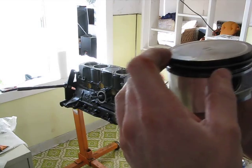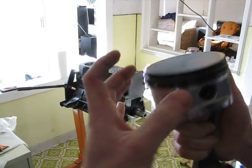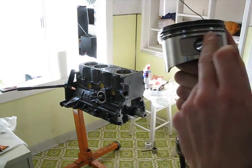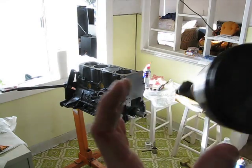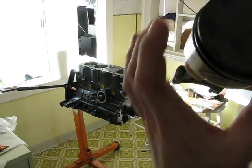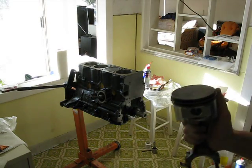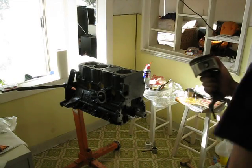Wait, I'm sorry — that's the incorrect way. This one's 180. So we have bottom oil ring, and then one, two, three, and then bottom oil ring here and top oil ring right about there. So we've got about 180 degrees, but not directly across the piston pin area. And we'll kind of situate that. I'm going to go check the book just to make sure I said that right. Yeah, top ring is up to the right — now we're good with that.